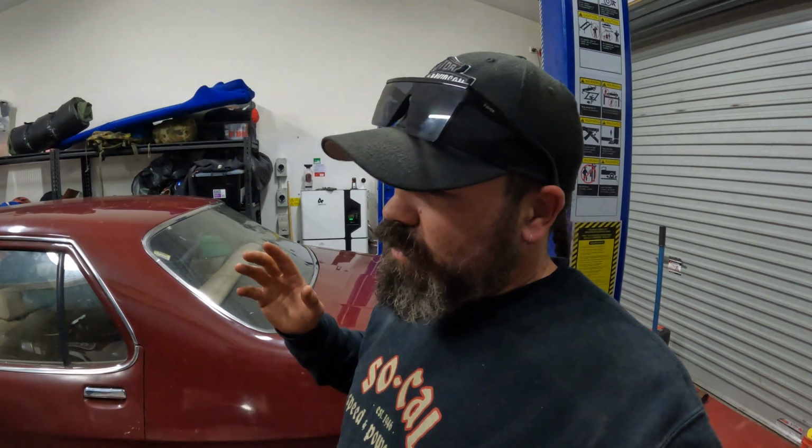Right, it's been a week, but since I was just showing you the old tyres that I pulled off and they were scuffing, I put the new tyres on. So the tyres that were on it were 225 65 14s, and I got some 215 65 14s. So it's roughly about 10 mil narrower tyre. Takes about 5 mil off the inside, 5 mil off the outside. So that's all it was roughly scuffing by. It's worked out all right.